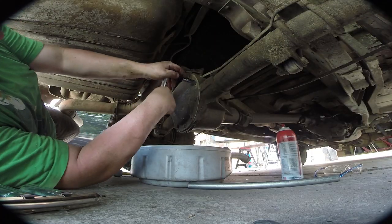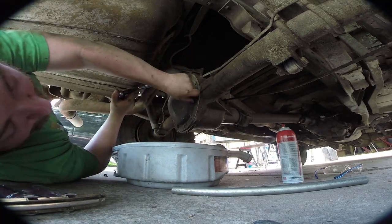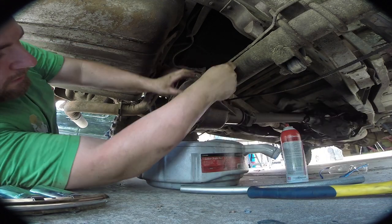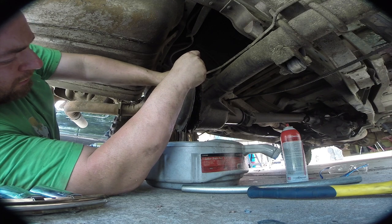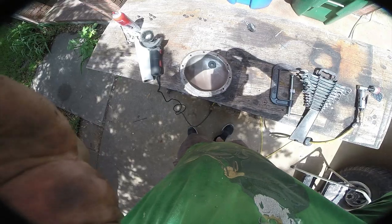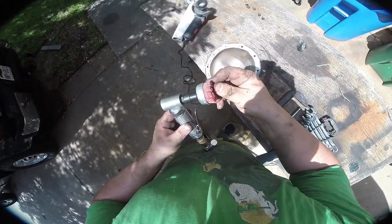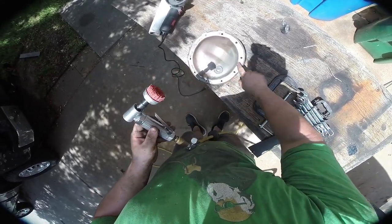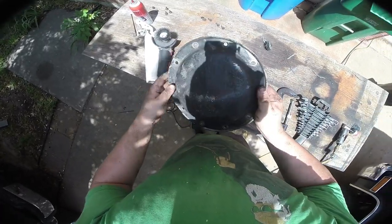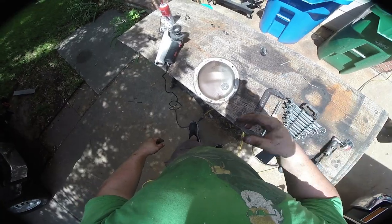Not a whole lot of debris down here — at least some fluid came out, that's pretty good. When it comes to cleaning stuff like this, the outside is normally just a wire wheel, and I'm using a special plastic pad on an air grinder for cleaning the schmutz off. Clean the magnet out, hit the back surface nice and clean — it'll pick up more dirt along the way. Now we're going to put down a layer of RTV, clean up the other mating surface, put the gasket on, and start bolting it all down.